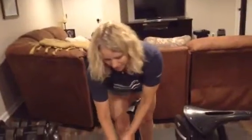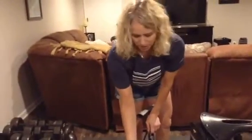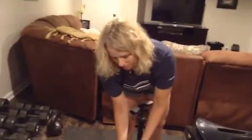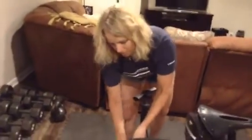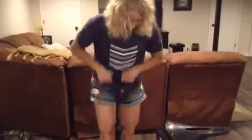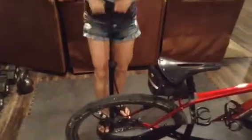Okay, now that that's seated on, I'm going to let the air out of the tire. Then I'm going to pump it back up again, this time to 35 psi. That I will run in the back. Now I'm putting it to the weight that I will ride it at, the pressure.